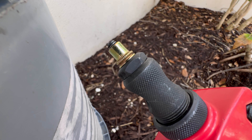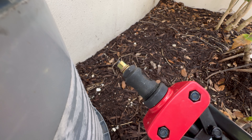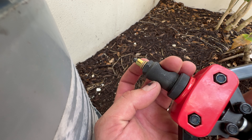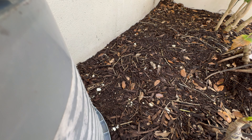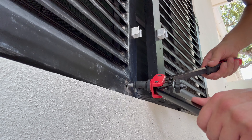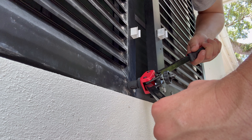I'm going to show you how this tool works using a steel one, so I don't waste my stainless steel ones. Basically you thread the rivet nut on all the way, then squeeze the handles together — see how that does that? That makes it fastened inside the hole. On this tool you can loosen it up a little and give it a couple more turns if you want it to close up more, then squeeze again. That's essentially what the nut is going to do inside the hole. We'll take that off and get back to the stainless steel one.